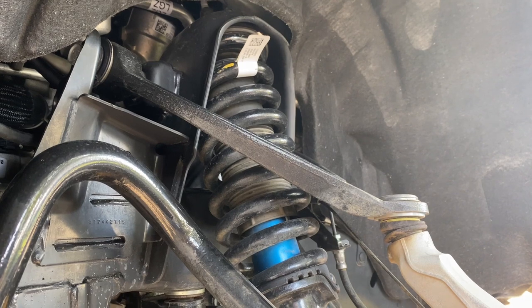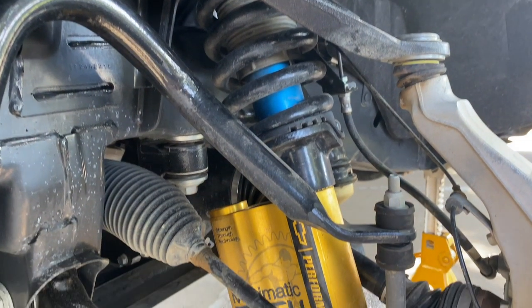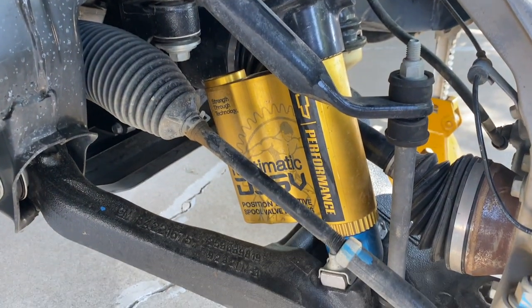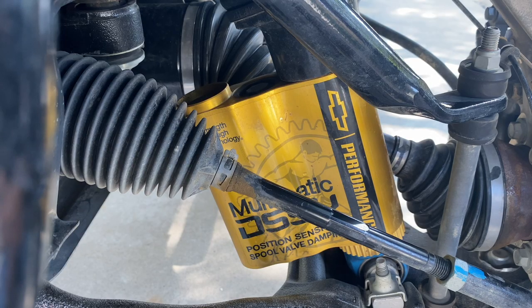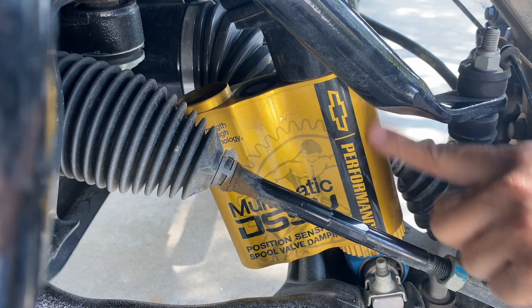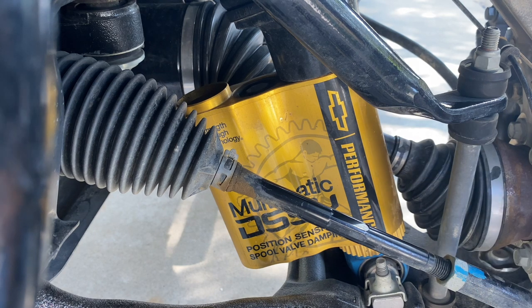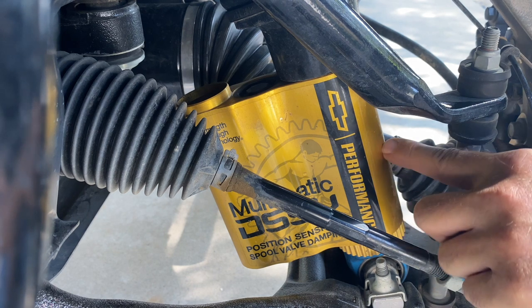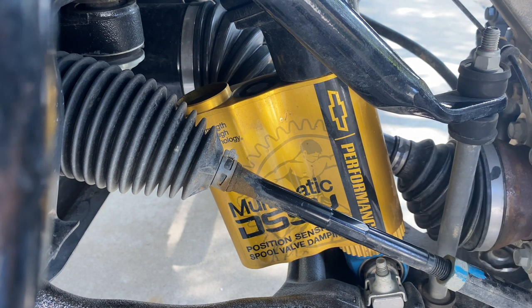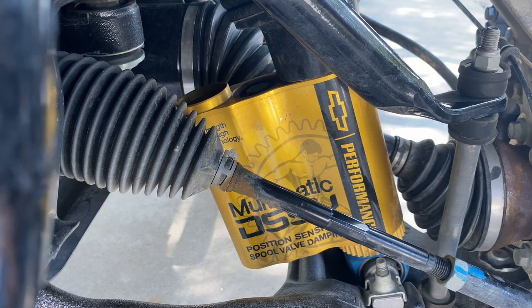Like most other off-road trucks, the ZR2 has coil-over dampers with remote reservoirs, but these are completely different. Everybody else has deflective disc valving that's mounted on either side of the piston that moves up and down when the suspension moves in this primary chamber, but the DSSV system by Multimatic doesn't work that way. Yes, there's a piston in here, but it's basically pushing oil into this second chamber, which has 2 spool valves, one for rebound and one for compression.